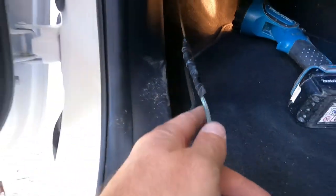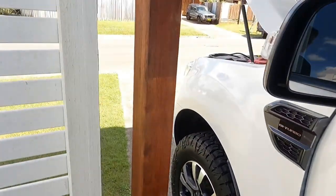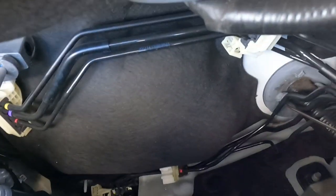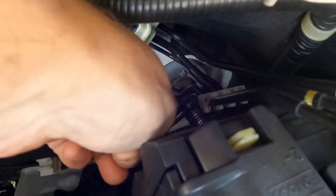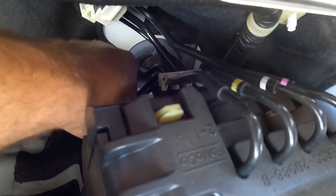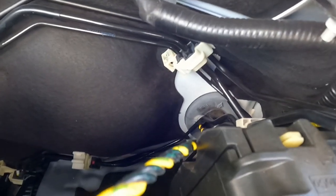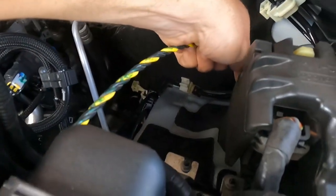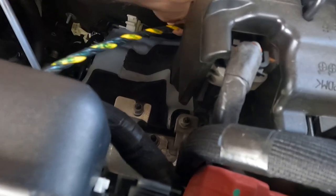I've poked this piece of silver solder — though you could use a coat hanger — through that rubber grommet up in there. Then I've taped my snake to it and I'm going to pull it through from here. Then I'm going to pull the cable back through that way. It does say to do it very carefully so you don't ruin any of the original wiring. Two people would be handy for this one but I'm by myself, so we'll see how we go through the firewall.